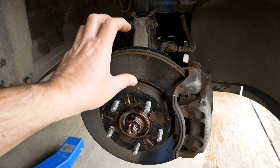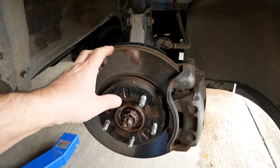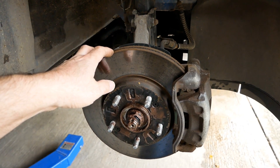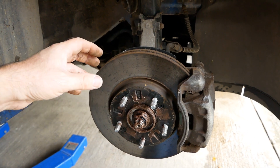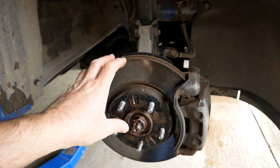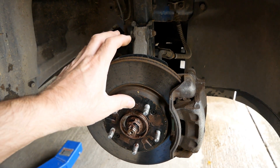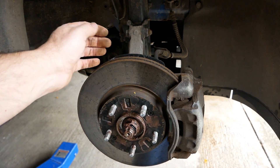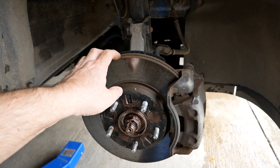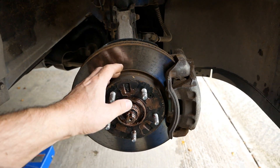The result is that with an EV your brakes end up making more noise due to lack of use. You'll particularly notice it in the morning on the first pull-away, because your brake discs will have got dirty and corroded overnight — especially if it's been damp or rained. That first few miles are going to be a bit grindy and gaunchy, exactly the same as on any other vehicle, but you hear it more in an EV because there's no engine noise drowning it out. It's compounded because you're not using your brakes much, so the rusting and scoring stays longer. If it's getting particularly bad, all you need to do is just use your brakes more.